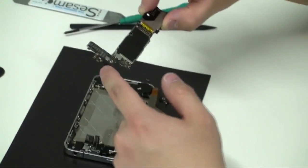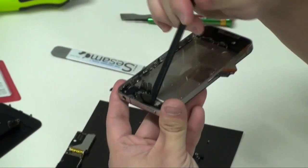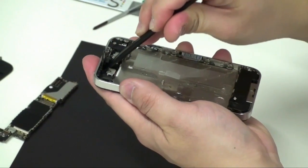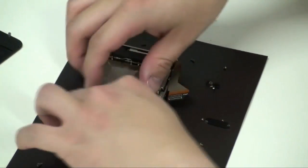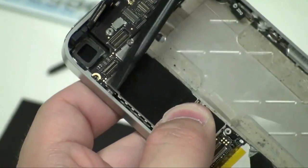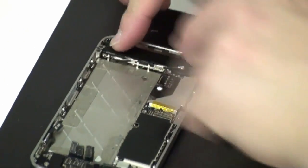Place the board in gold-pin first against the north side of the phone. Before doing so, keep in mind that you'll be pressing against the LCD and digitizer cable, so for inexperienced repairs you may want to fold the cable first towards the inside of the phone. I'm placing the logic board back into the chassis. Make sure that these little metal pins are flush against the board — there's one there and one over there. You should have it flushed against the chassis, then proceed to screw in the other side of the speaker box. It's highly advisable to also screw in your flathead, as it secures the rest of that side of the board.